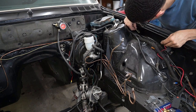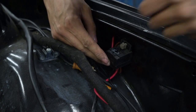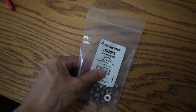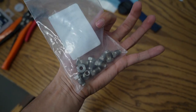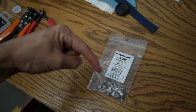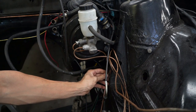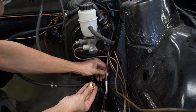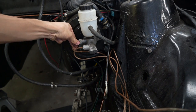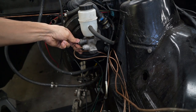Now I can just push this extra wire back in here and tuck it away. The relay is plugged back in fully and my wire is tucked. My bubble flare brake fittings came — these are stainless steel, the first time me buying stainless brake nuts. The link is going to be in the description, I got them on Amazon. Now this rear brake line came out to the ABS pump, but I can shorten it to about here, and right where my hand is is where the little three-way junction is going to sit. I'm going to tighten the brake line in all the way just so I can get exact fitment — that's what I've learned working with brake lines.